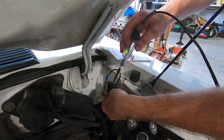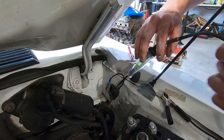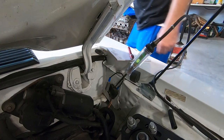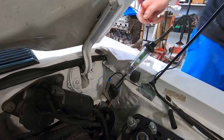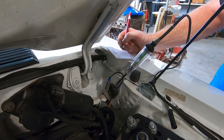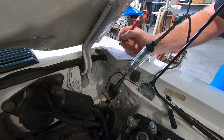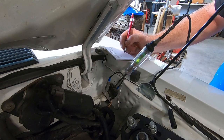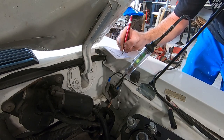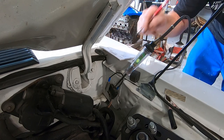When you're looking at the plug, the bottom left of the V is where you want to put one side of the jumper; the other side goes into this terminal. I'm going to do it with a test light — you can see it is on. So now we're going to turn the ignition on and count the flashes. One, two, three, four, five, six — six, seven. With the engine off, it looks like I only have code 67. Now I'm going to start the car and do the same thing.